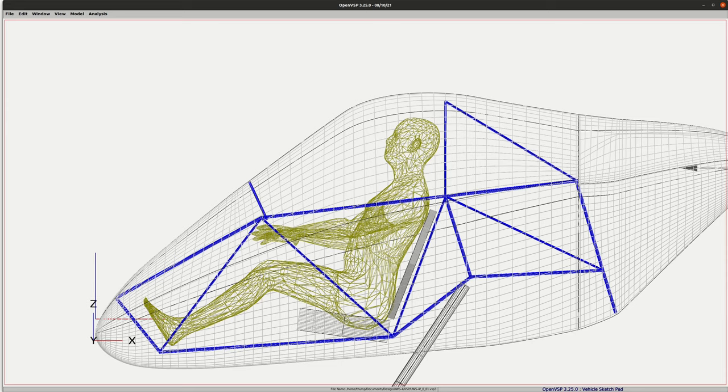Since I have unanswered questions about the tubing layout for the cabin, I'm seriously considering making a mock-up using square wood dowels and scrap wood — not for structural testing, but for fit. I'd mock up a seat, foam cushion, instrument panel, and tube positions, then also do a rollover test: roll it over, be in it with a five-point harness, disconnect the harness, and see if I can crawl out.